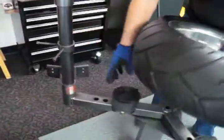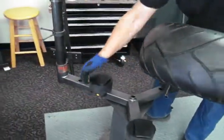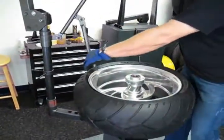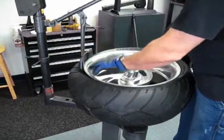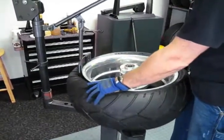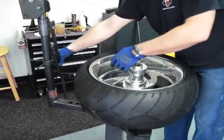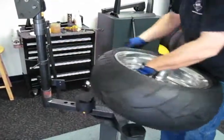I'll move the rear block to the peg hole with the yellow dot, let the air out of the tire, lay the wheel on top of the blocks, and break the bead with the non-marring wedge bead breaker tee. Thoroughly break the bead all the way around on both sides, then you'll be ready to lock the wheel in.